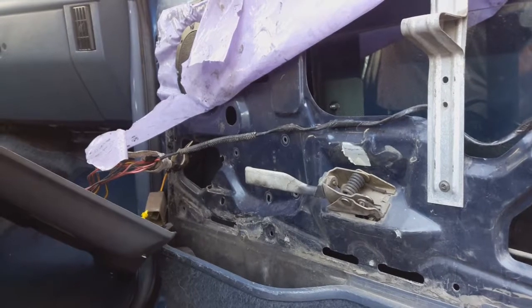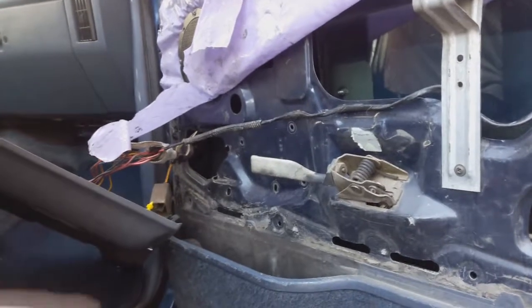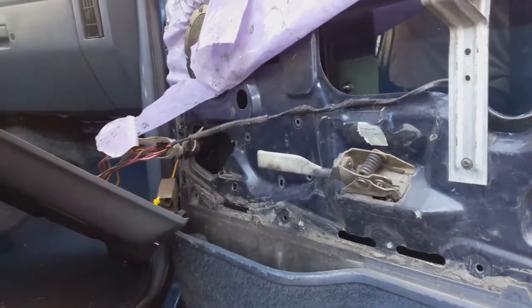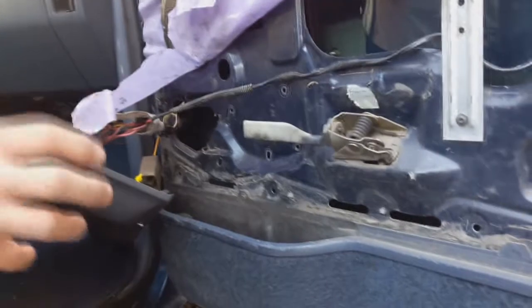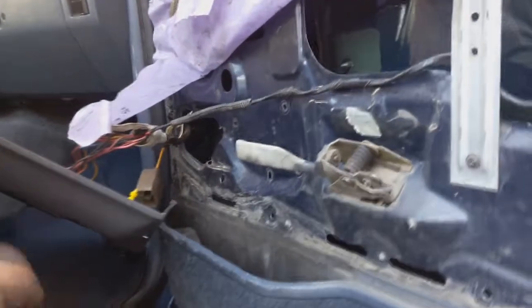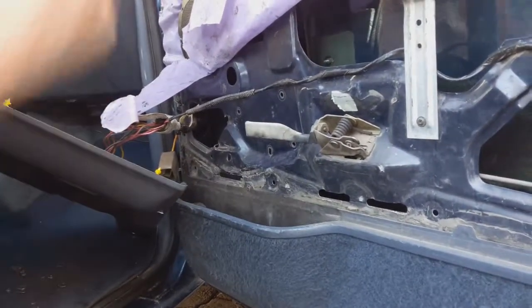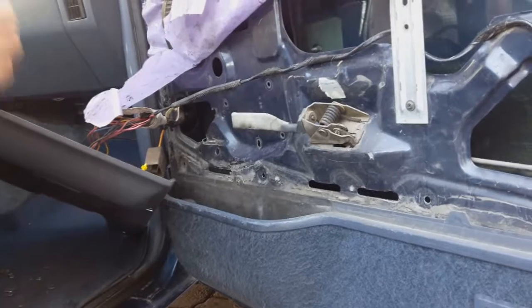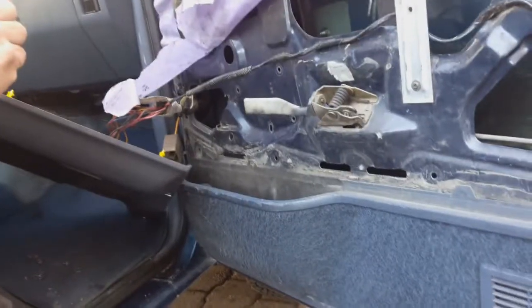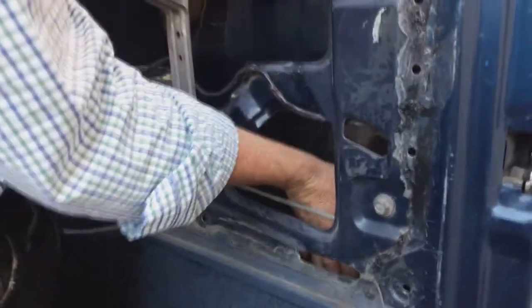I changed the motor. I have replaced several things thinking that it's something else, but it's actually not that. There are some pieces that wear out, like some plastic rollers inside the motor mechanism. But in this case, everything is new and it is still doing the same thing. It gets stuck in the lowered position. Some people have removed the stop at the end, and it seems to work a little better. Not always, but it keeps the window from rolling down fully.